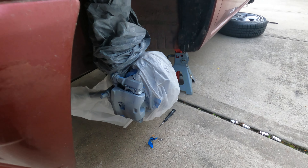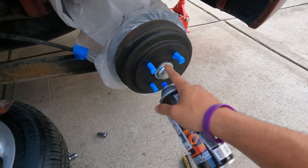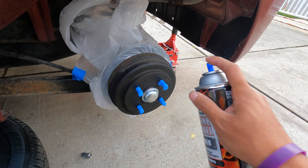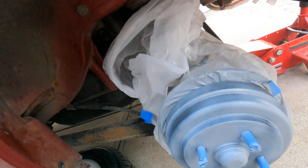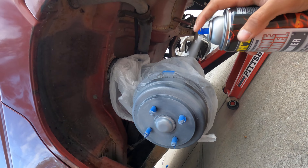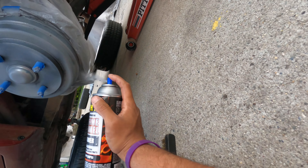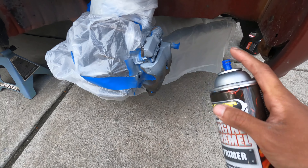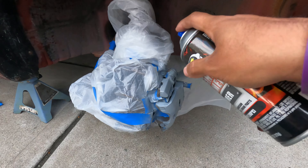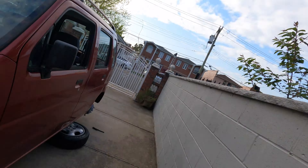Okay, that was a little more than gentle — but that's fine. For the drums you've got to make sure you go under and get all around, because when they're spinning it'll look really gross if the bottom isn't covered. Give it about 10 minutes between each coat. It's not really warm outside today and it's actually kind of windy, but 10 minutes should be fine. This is a pretty heavy coat but you get the point — 10 minutes, then do it again. We're going to do at least two coats of primer and three coats of yellow.